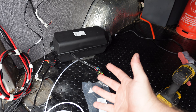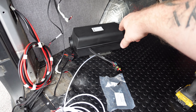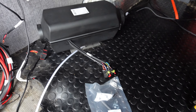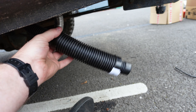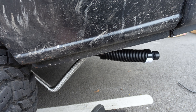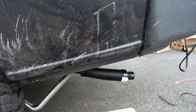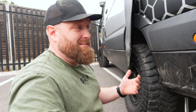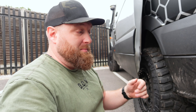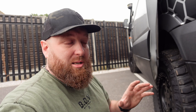Nice. As you can see now, all the gubbins is down below. I can put four fixings in there - you can either nut and bolt this, however I've got a nice solid wooden floor so I'm going to screw into the wood. We've now got the electrical here and the fuel pipe here. What we then have is the air in and the exhaust. We're going to put the heatproof sleeve on this piece here, then fit the air in one way and the exhaust the other way. Effectively, by pointing them in different directions, if you're sat on tickover parked up overnight, the last thing you want is to draw the exhaust fumes from the diesel heater back into the air that's coming in. That won't run well. The chambers are two separate parts, but the direction still matters for airflow.